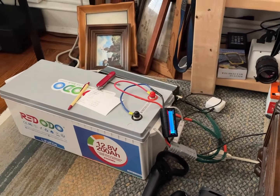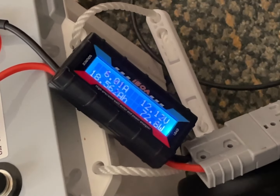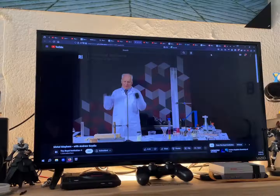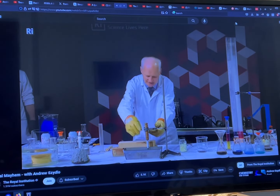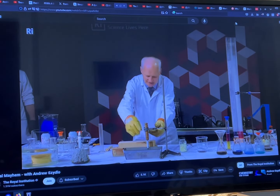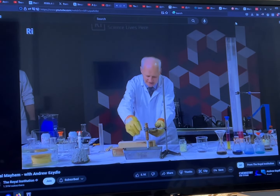The meter shows 13.12 volts — let's check the actual voltage: 13.17 volts. That might be around the 50% mark. I have it running on the TV, light, and sound system watching the pilot debrief. The voltage is going down — 16.7 amp hours, 211 watt hours, 12.27 volts. Let's see if balancing this has helped at all.